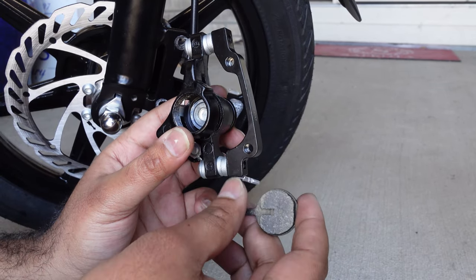Now we're going to go on the other side of this wheel to reach the adjuster, which is right here. You want to reach from this side and go ahead and tighten the adjuster. Go ahead and tighten it until it reaches your disc, but then go back about a quarter of a turn.